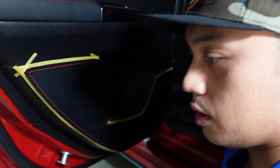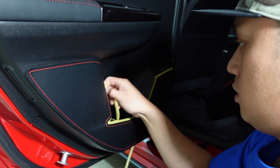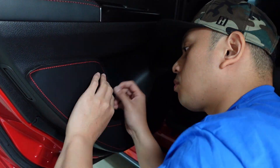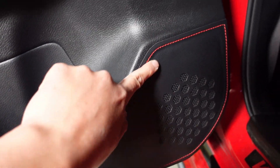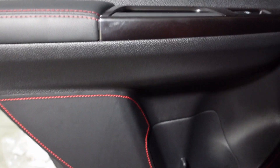After the adhesive promoter, go ahead and remove the stencil, and then finally peel the backing off the edges. Just like the driver side, watch out for the crease right here as well as around the speaker. Other than that, you just move it as necessary to get the final fitment you're comfortable with. I finished the driver side and I'm going to get started on the passenger side — I'll just breeze through this since I don't want to feel like I'm repeating myself. After I finish, I'll provide you guys with my final thoughts.